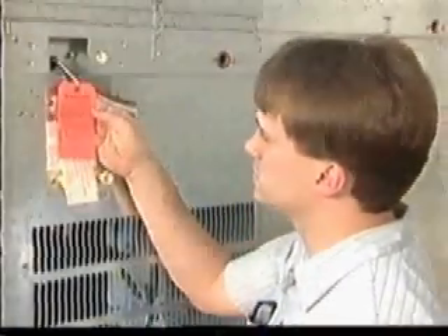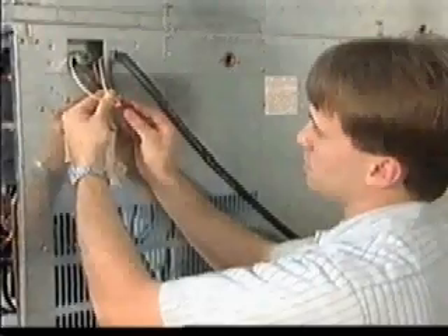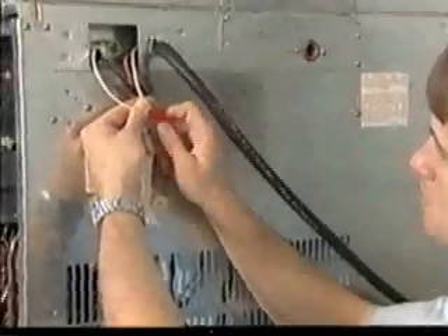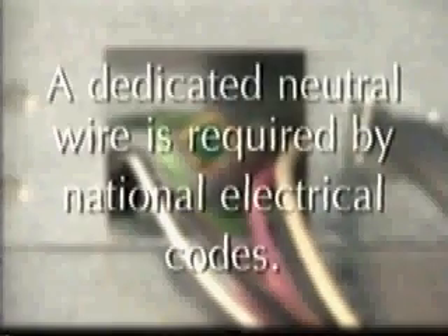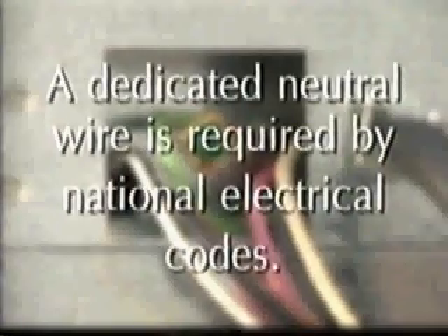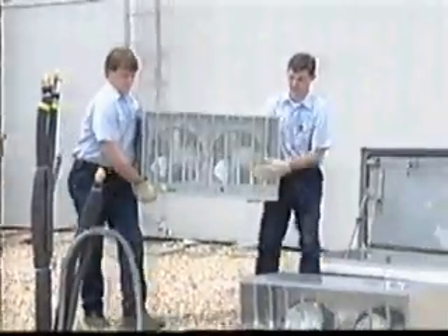When making the electrical connections, it is important that they be made in accordance with the instructions on the warning tag provided with the leads in the junction box. Make sure the white leads are connected to the neutral conductor of the power source. To prevent possible electric shock or damage to the machine, be sure to install a proper ground wire to the ice maker. On 208/230-volt single-phase applications, a dedicated neutral wire is required by national electrical codes. A separate power supply or receptacle is required for the installation of each ice maker. Be sure to check the nameplate for proper capacity.